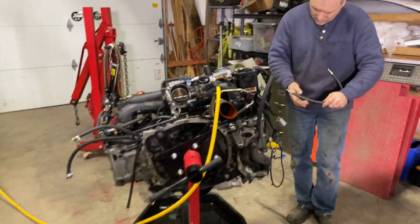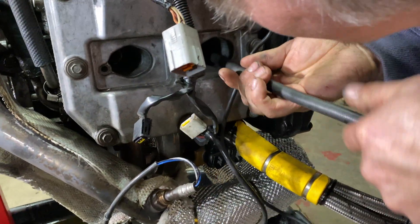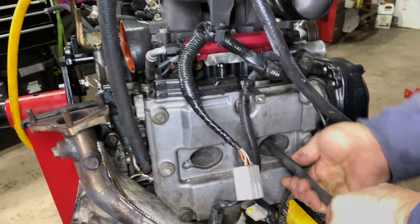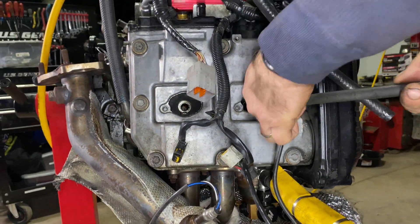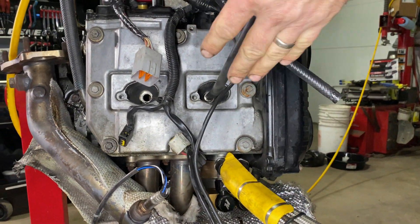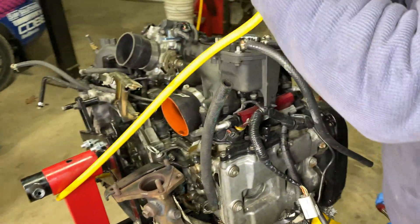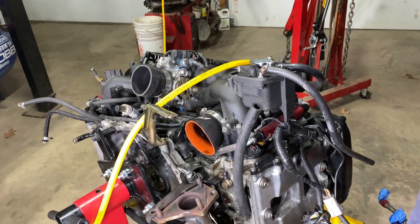First thing, I'm threading the hose through the spark plug hole. It's much easier to do it on an engine stand. You can see here I have the hose in the spark plug hole. When you do that in the car — especially on the supercar with a tight spot to get to — you can do it in the car, it's just not that easy. For the test to work we need to be at top dead center for this cylinder.